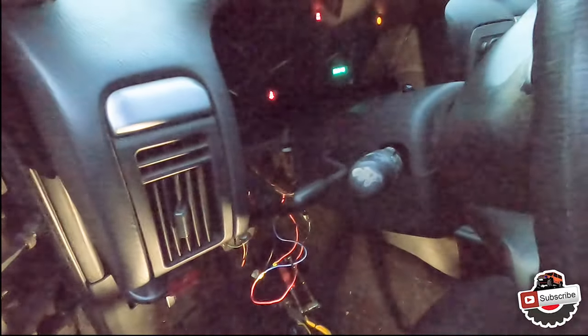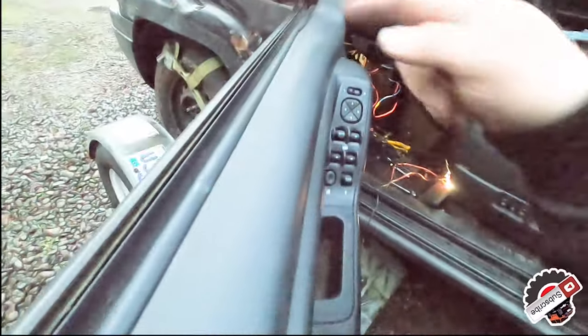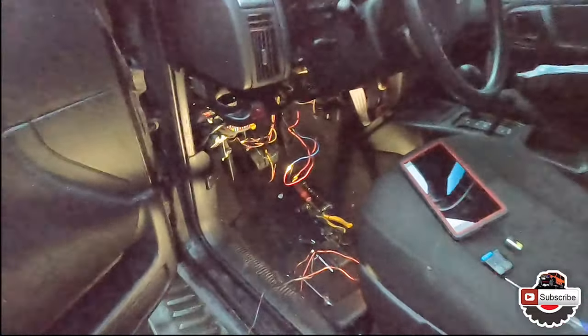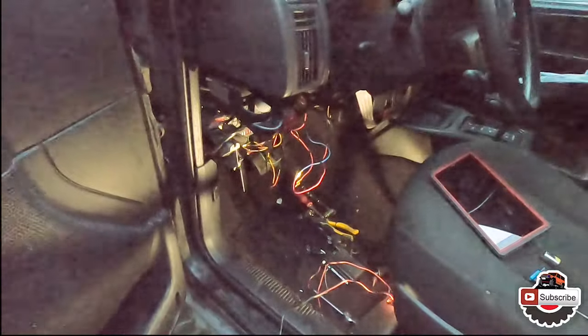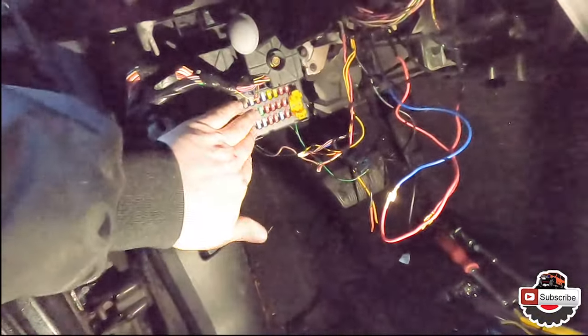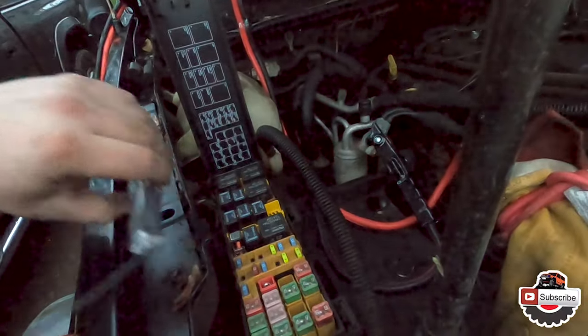What's really concerning is that security key light keeps coming back. My OBD scanner has no connection to the PCM — either the accident disrupted the wiring going through the fender along the apron and through the front, or it blew a fuse or broke a relay. I checked every single fuse in the main fuse box — they're all fine, none blown, I checked the diagram. So let's go take a look at the other fuse box on that side.